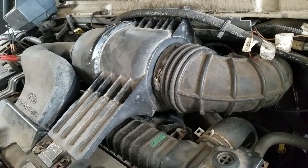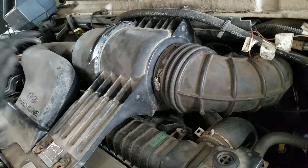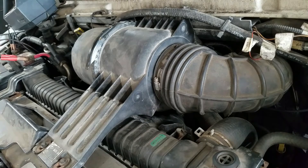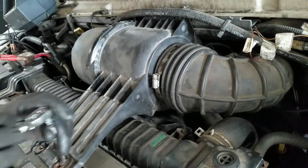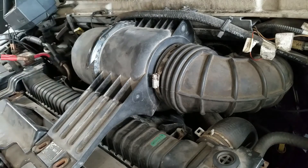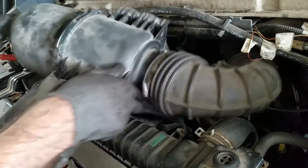First thing I'm gonna do is make sure that the wiring is okay and make sure I'm on the right sensor, because sometimes some vehicles have a couple of different sensors — one for the gauge and one for the computer. I'm pretty sure I know which one it is. I gotta get this air box off; this thing just pops off — you turn it up and slide it out. I've got an eight millimeter hose clamp here, and there's two eight millimeters up here too, but I can just slide it out.